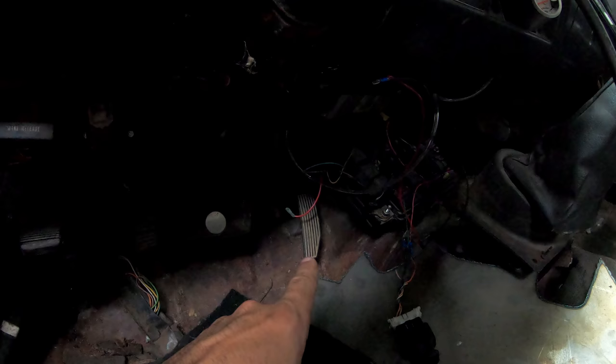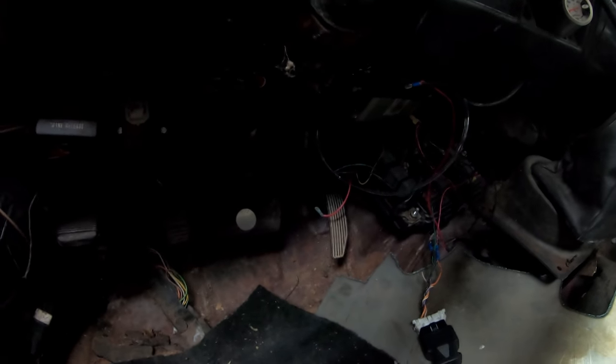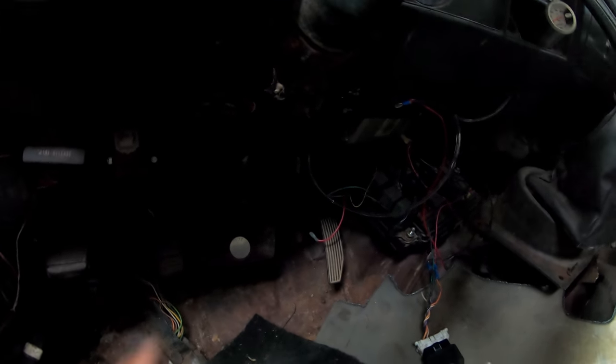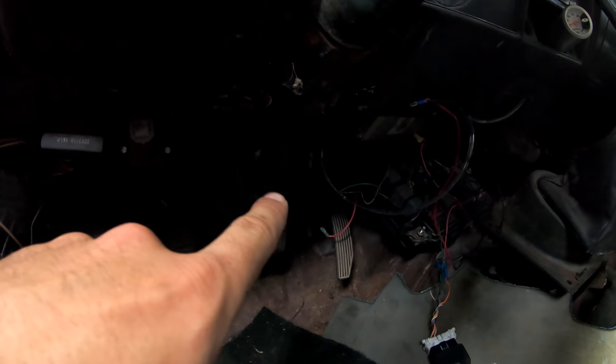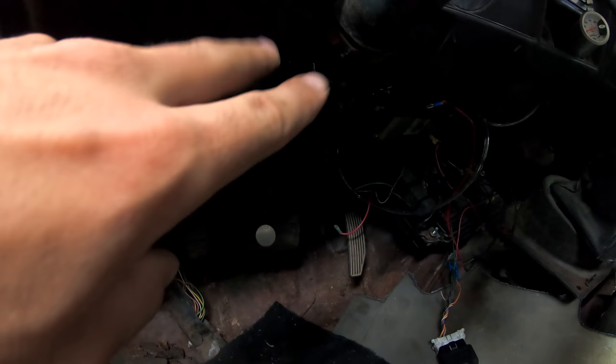Colorado accelerator pedal, because this is drive-by-wire. So there's about 4 or 5 wires that you just have to wire into the ECU. This pedal, bottom mount hole to the factory pedal location. Two tops were just some screws that we shot. So everything lines up pretty nice.